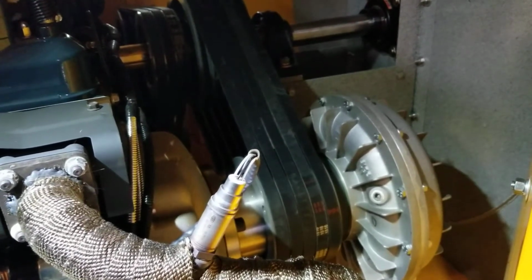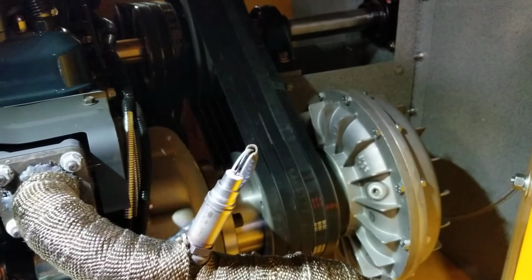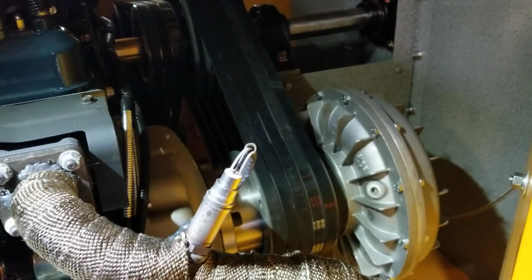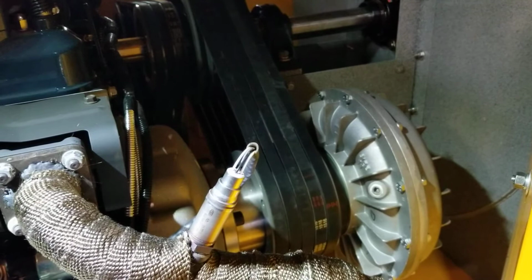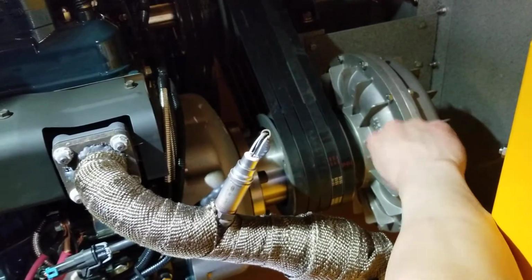The less slip you get out of your fluid coupler, which is what we're shooting for, the less heat it builds up, and the longer it's going to last you. And therefore your oil won't break down as soon, and it'll last better. So just make sure the X is up, fill it till it starts to flow out this hole, and then put your plug back in.